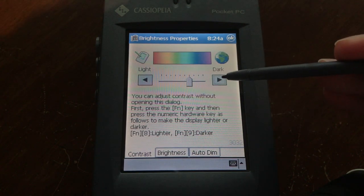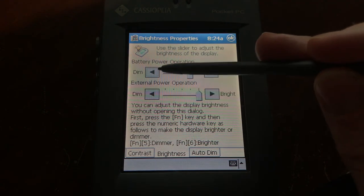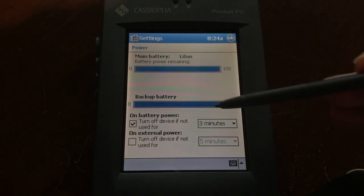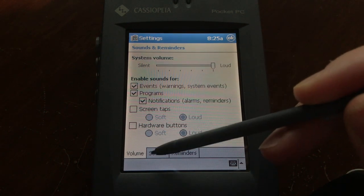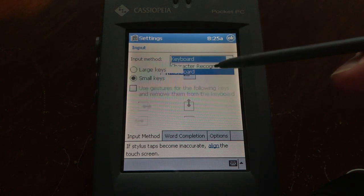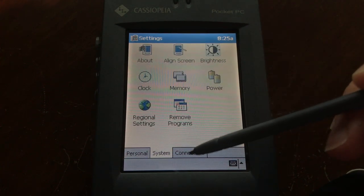The screen on this is actually really nice — it's an active matrix display. You can adjust the contrast however much you'd like. The brightness gets pretty bright even on battery power. We'll leave it lower for battery life, and it has an auto-dim function. The power screen shows you how much battery is left and how much is left in the backup battery as well — as an approximation. You can customize what the buttons do, the input method — it has a character recognizer or a keyboard — and you can customize the menus and what appears in the start menu. Performance of this PDA is actually pretty snappy; this MIPS CPU is not half bad.